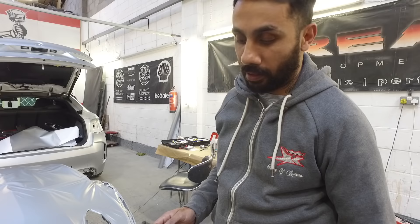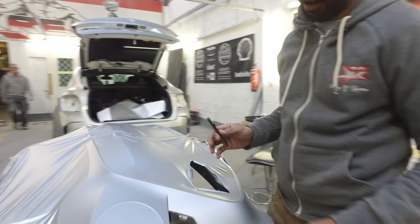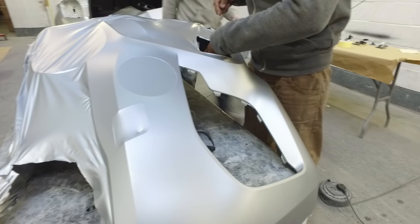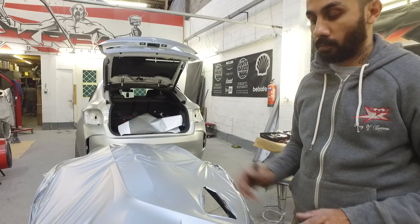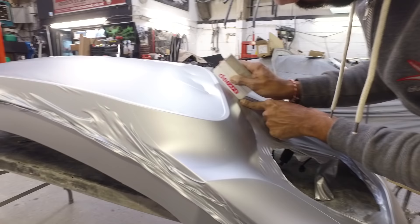So we've just done this side of the bonnet. We've done infills in here - this part of the bonnet is gloss black, which kind of breaks the car up a little bit. There's a little bit of an infill in here - this is quite deep, about two or three inches, so you're never going to get the throw on that. So we put infills only where we need to, not really anywhere else. Because if you stretch it, it just gives and it will break and it won't last.